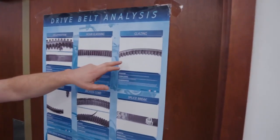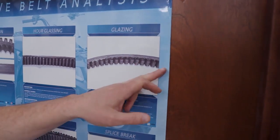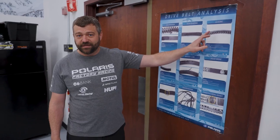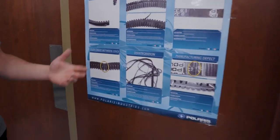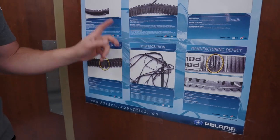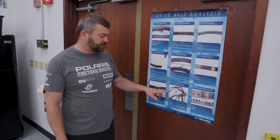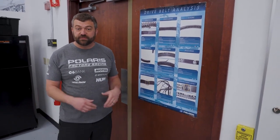If you get any oil contamination or a belt that's just way beyond its service life, it'll start to get real shiny and real skinny from that belt slipping across the whole length. Fix the cause of the oil contamination first, then swap your belt. Broken belts and disintegration are less common - a broken belt is often from a shock load, going from looser terrain to one with way more traction. Disintegration often happens when you don't have a proper break-in, your belt runs too hot, and you keep pushing it hard without following best practices.